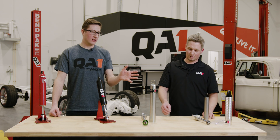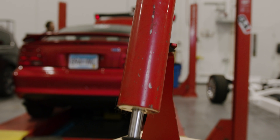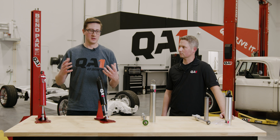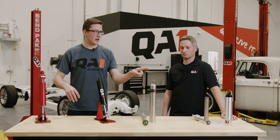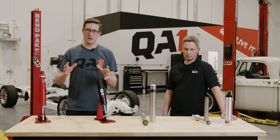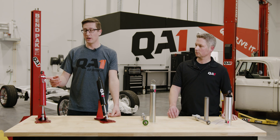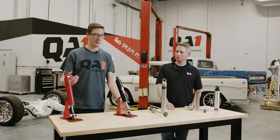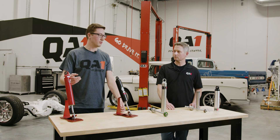Now that we've kind of gone through the advantages and disadvantages of the monotubes, let's take a look at the twin tubes. I use these on three corners of my car because I race on a lot of smooth, dry slick tracks. When you're trying to feel where the traction is at, having that base valve gives you a little bit more feel for what's happening. Another big advantage — this is one of my shocks right here, obviously took a dinger, and I was able to finish the race. This would need to be rebuilt, but it didn't stop me in my tracks. The shock could still travel a little bit because it didn't hit that internal compression tube.